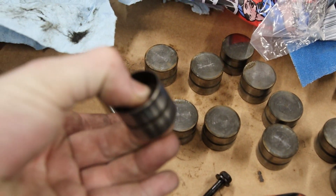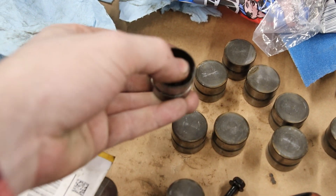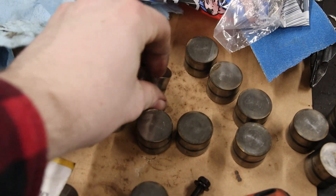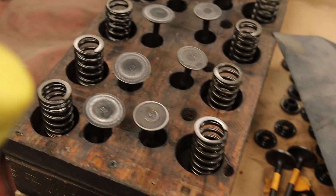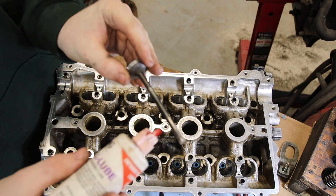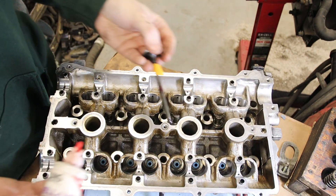These all press down for very minimal effort, so I don't need to clean them. There's probably going to be some valve tick, but not that bad because they're all free moving. Now it's time to put everything back together. I've got some oil here — I'm just going to oil every one of these valves and stick them in, then flip it over and put the valve springs in and the keepers. What I'm doing to lube these valve stem seals is taking a valve, putting assembly lube on it, and shoving it down there to lube up the hole.